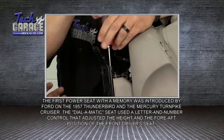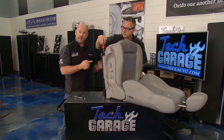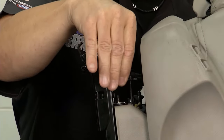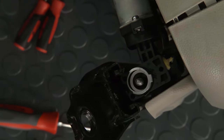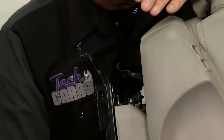So this is really important. If you're doing this, the tracks have to be phased — which means you don't want to have one track way further forward or backward than the other. Because if this is a gear issue and we replace it, then you're out of phase and you're not going to get the travel you want, and you could damage that gear. I see some splines but I don't see anything going on in there so far.